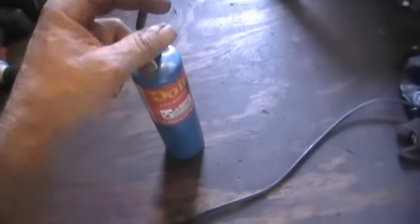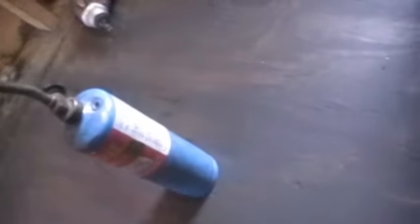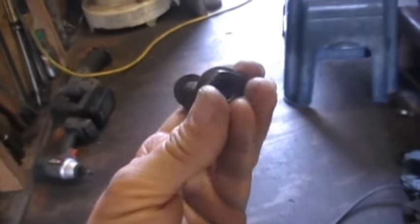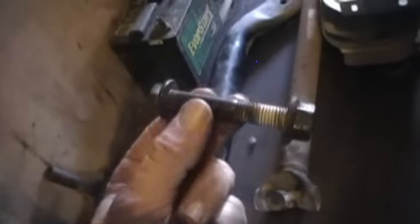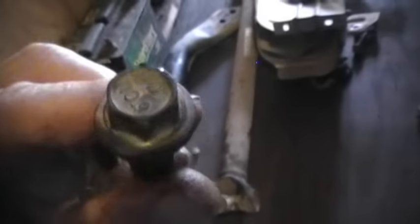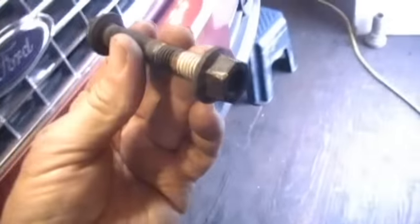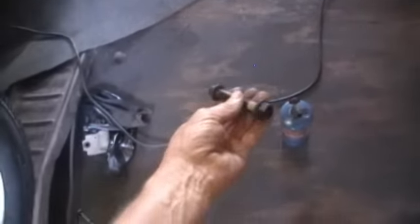There's my propane torch that I use to heat up my bolts — nothing fancy, and it really helps to heat those bolts up and break them loose. The cross member was a pain to get out. I had to heat the bolts up, put a little oil on them, then took a 15mm on one side and an 18mm wrench to get them out. If you're having a hard time getting the cross member bolts off, I almost started grinding but then thought to use a little heat. It's amazing what a little heat will do.